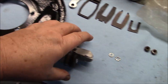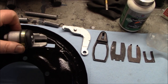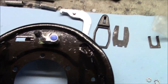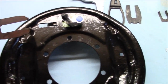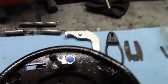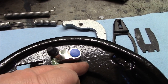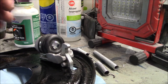The adjuster is in now. We're going to put our wheel cylinder in - it goes in just like this, fits through, and then we fix it on the back with the locking plates. Here's what the wheel cylinder looks like on the back of the brake plate. We grab our first locking clip and slide it with a slight arch on it, pins up. I've put a little bit of brake grease behind the wheel cylinder since it moves back and forth, and I'll put a little grease underneath before putting the tab on.